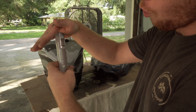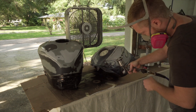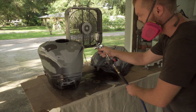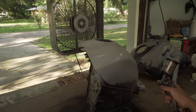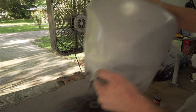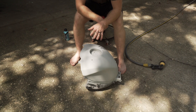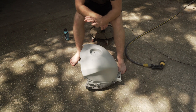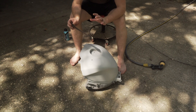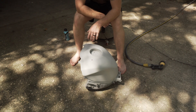So I'm going to mix it up good. This is four parts primer and one part hardener. I'm going to put my mask on, my PPE. So I just primed the S1000 tank again. I already painted it black twice and neither time came out well — you can still see imperfections where I sanded. So I sanded it all very well with 320 and I'm hoping after this prime job I can sand it down lightly, get all the high spots off, and then spray some black again and be done with it, then go to clear with the flake in it.